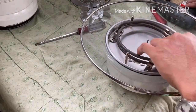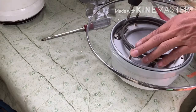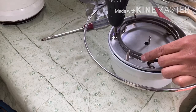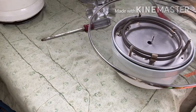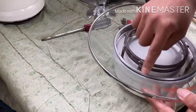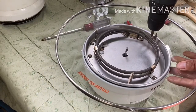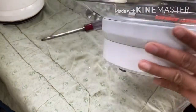Make sure the heating element is in the right position. Then put the screws in one by one, starting with the heating element first, then the hanger of the heating element. Make sure the glass is parallelly aligned. You can check if the glass is in its place.